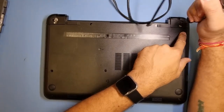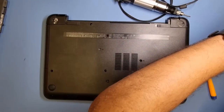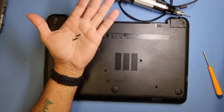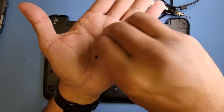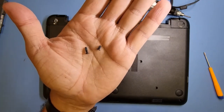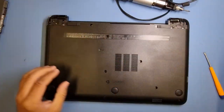That will reveal two screws. Take the screws out - these two actually. The ones that go into these plates, compared to the ones that go into the chassis, are a different size. I'll put one next to the other for a better guide: you've got one long one and the other shorter one just for the chassis. So just remember those two sizes, or use a template.